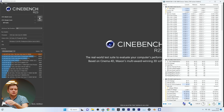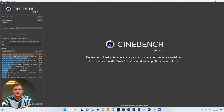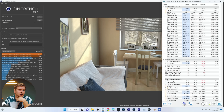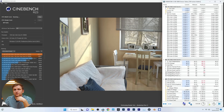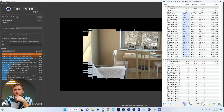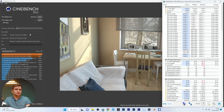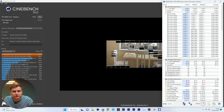This is just the first try — heating it up again. The room is about 0.8 to 1 degree warmer. Pressing start: thermal throttling pretty instantly, 40,270 points — very similar to what we got previously. Around 330 watts from the socket. Cores 5 and 7 like to run hot, which is normal. Putting 10 minutes on to see the final results.